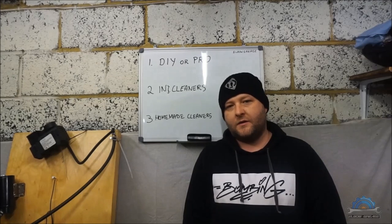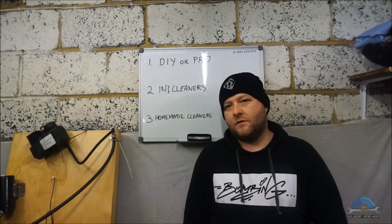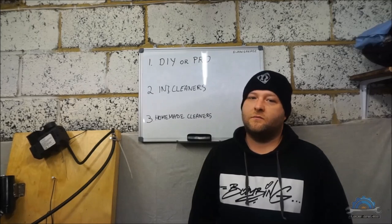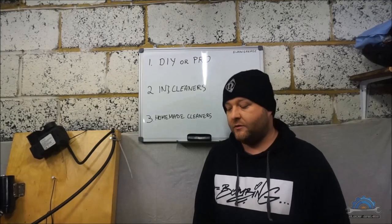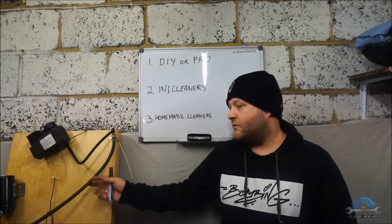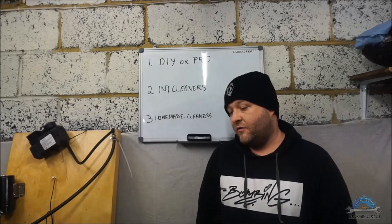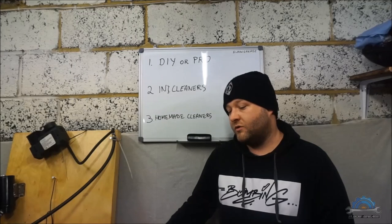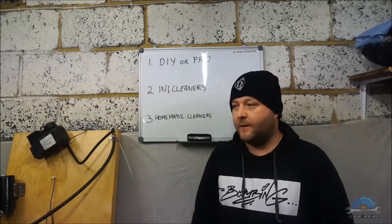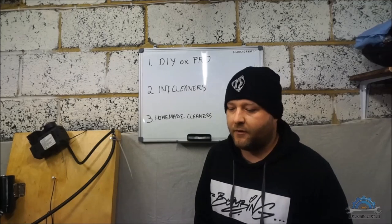I hope you guys find these videos useful about injector maintenance. So first thing, what's the best option, DIY or professionals? If you do DIY, you can use a similar system to mine: fuel resistant hoses, some kind of compressor, fuel line or any hose connection, and some voltage to open and close the injector. If you send them to professionals, they're going to do it for you. That's the best option available.